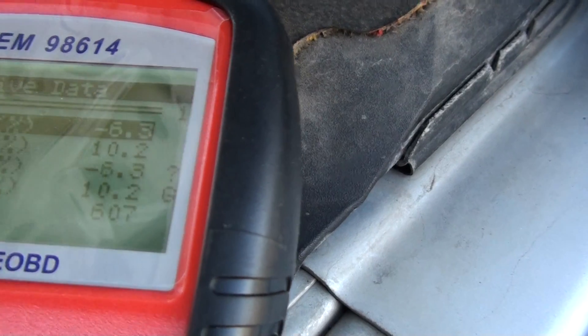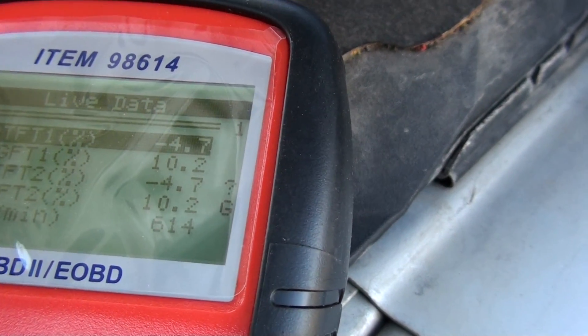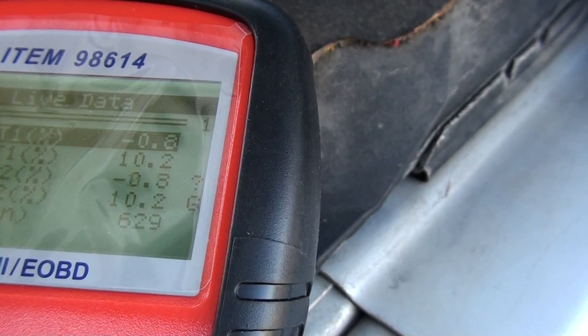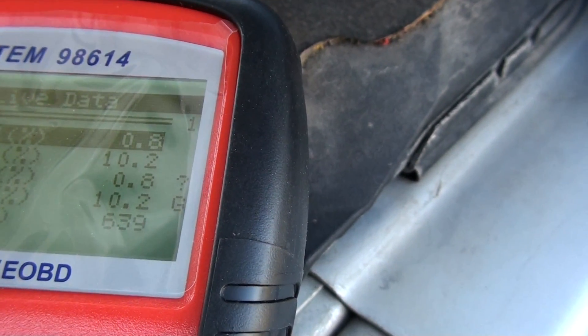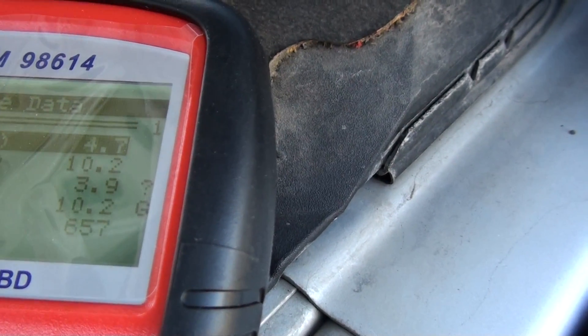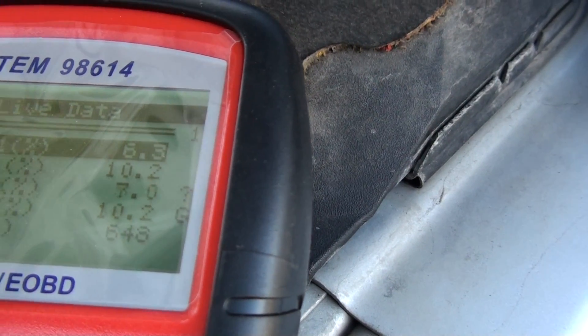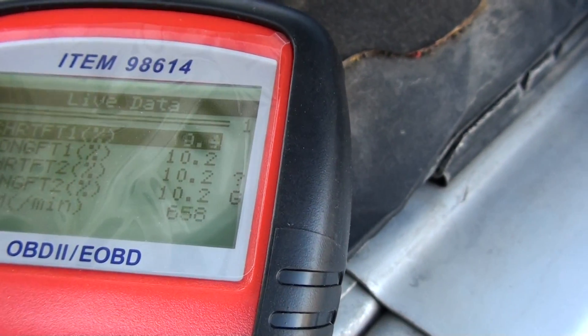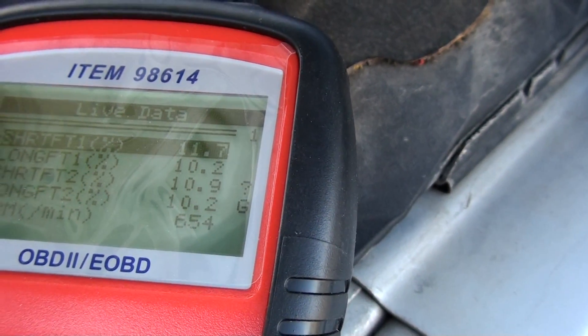Now look at what happens when I close the valve. I close the valve now. Engine RPM drops — almost to where it dies. You can see it was taking fuel away, and now it's putting fuel back. Sorry. Back up to 0.8. Now I'm putting in 3.9, 4.7 — trying to compensate. And that is up to 10% now, 11.